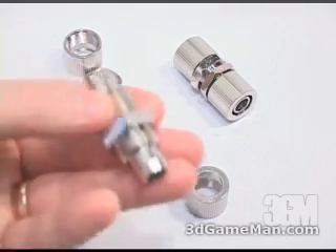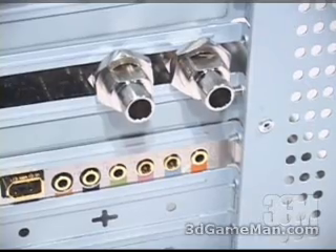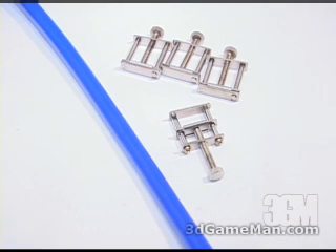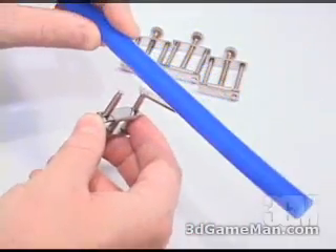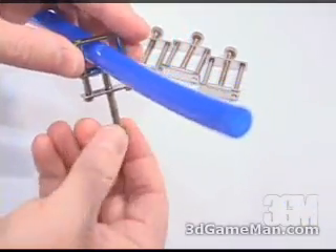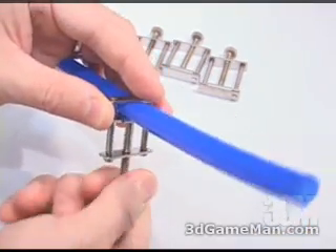These two universal fittings allow the tubing to run outside of your case. You can drill holes in the case anywhere if you want to put these through, or preferably put them in one expansion slot at the back of your case. These four clamps are used to terminate the coolant flow in the tubes. To use a clamp: swing the bar open at the top, slip the clamp over the tube, swing the bar back, then screw it down. This is great for maintaining the system or replacing or adding a water block.